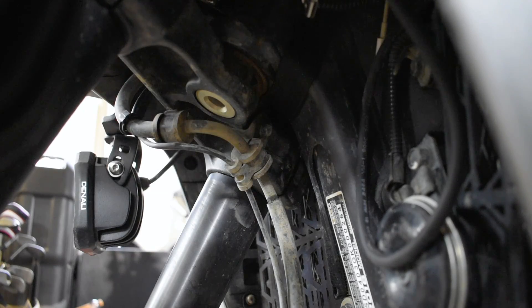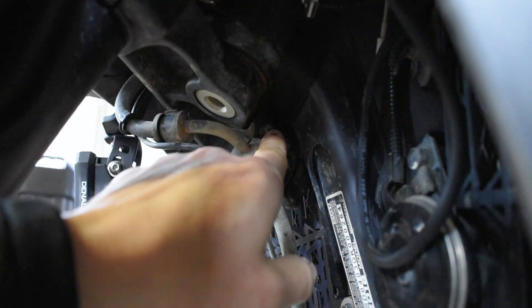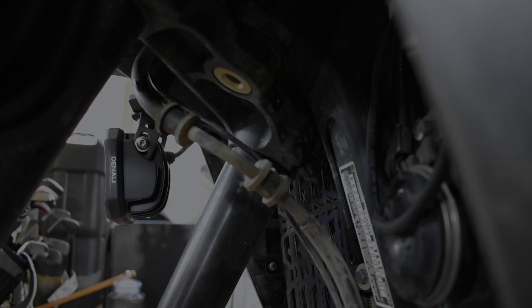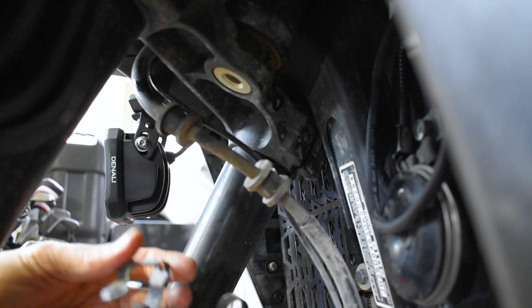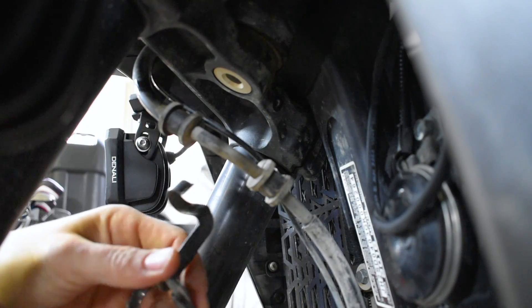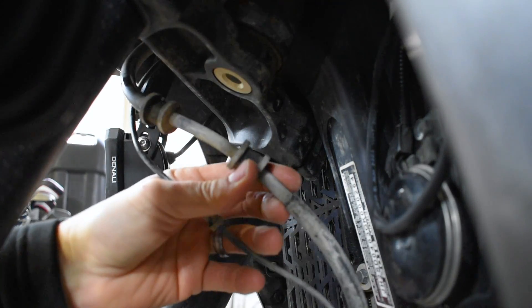Before we can mount that bracket, you have your brake lines here — this is the neck. You have this 8mm bolt. We need to take this off and remove the ABS and the brake line and get them out of the way. After removing the 8mm bolt, you have your clip that's on there. This is very bendable metal — just move this out of the way and unclip it. You have this little black plastic clip that holds your ABS to your brake line. Go ahead and remove those and get those out of the way.